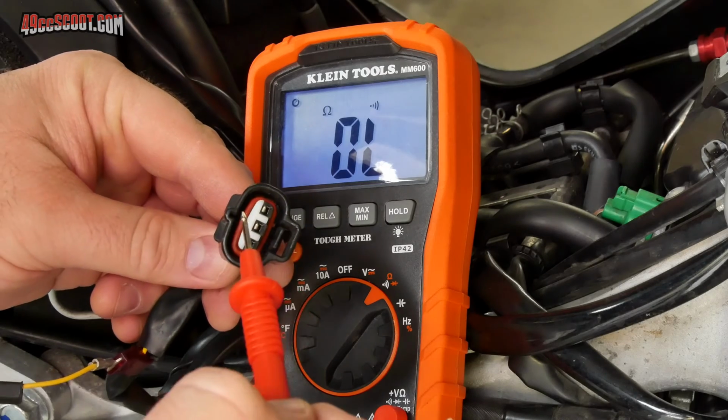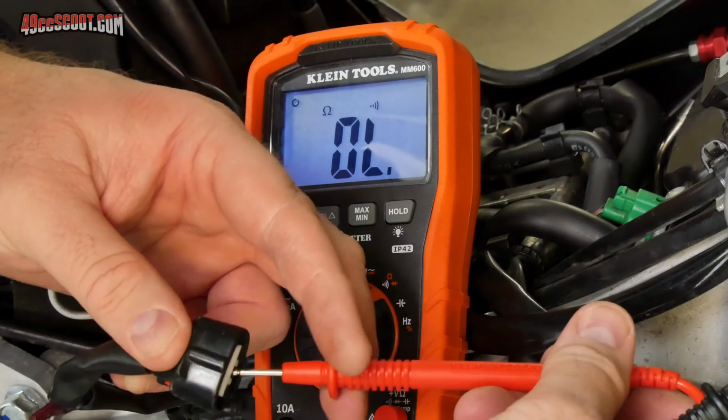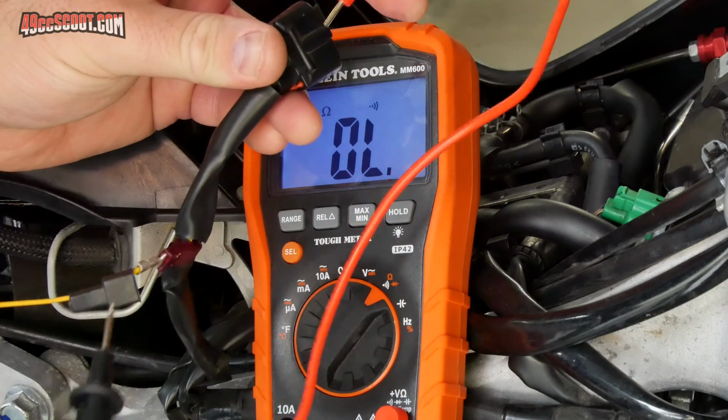When using taps like this one, I like to check the connection before moving on because it is possible that the wire moves or otherwise doesn't form a good connection. The easiest way to check is with a multimeter. Connect one probe of the meter to the center terminal in the TPS connector where the yellow wire is, and the other end to the terminal as shown.